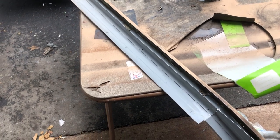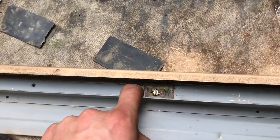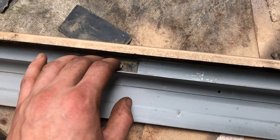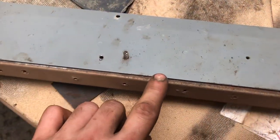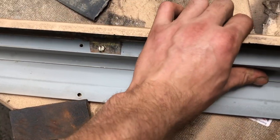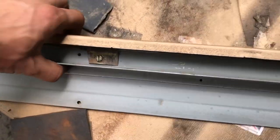I'm about to put the new track on. The upper track is going to get welded to the bottom part. I've cut the excess metal and left tabs to locate it - this shouldn't be an issue because I had these tabs on when I test-fit the door. My plan is to run tacks in the back to hold it on nice and good. I've sprayed the top surface with Copper Weld.